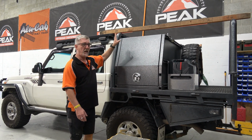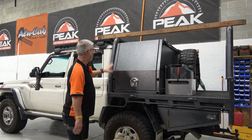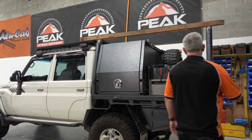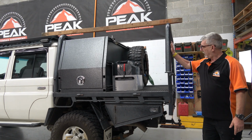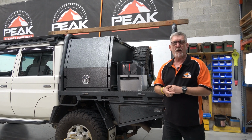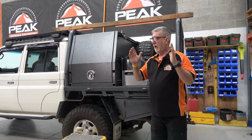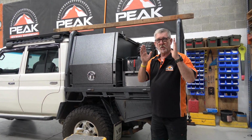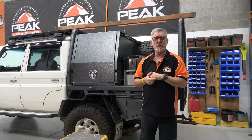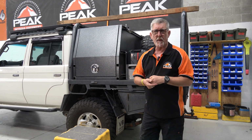Now as you can see, the tent is quite long. This is 1800, close enough to, and it's a standard tray. It has a hoop bar at the front and a hoop bar at the back. With all hoop bars, the big issue is they move. Some a lot, like this one, and others not so much. Either way, when you span this amount over corrugations, unsupported, this hoop bar will slightly move like this. It will flutter. And if you know anything about aluminium, it doesn't like that. The stress gets on them and aluminium will crack. Plenty of photos about all that.